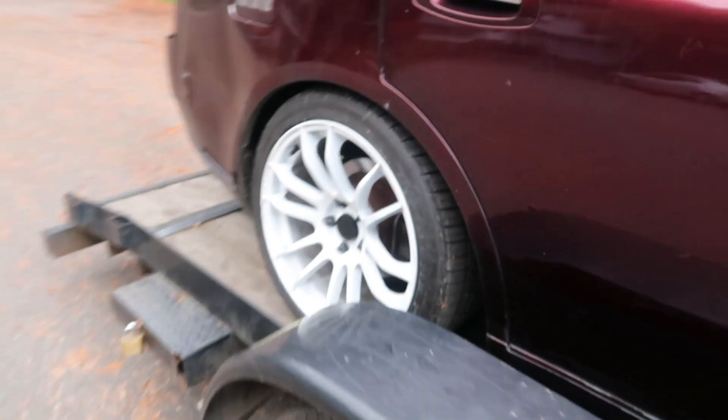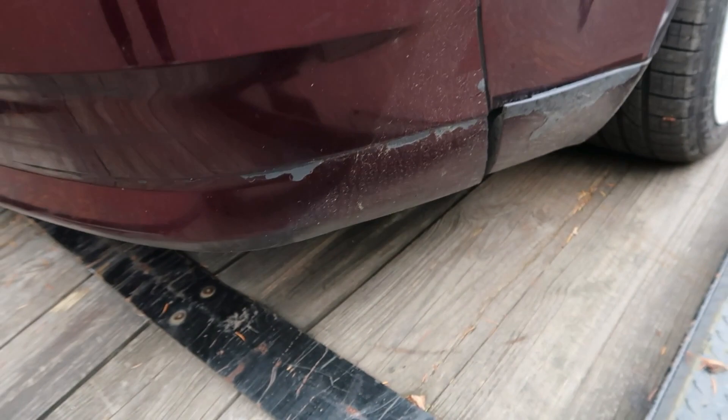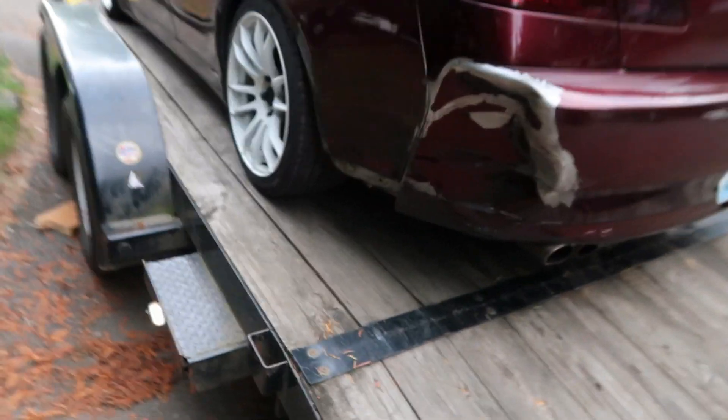This video probably doesn't have a lot of footage, but I did fix that ground thing. I had some of that heat-resistant tape that's like made of aluminum — it's kinda like a metal tape — so I put that on there to stop the hood from rubbing on it and chafing through the electrical rubber tape that was in there. Checked the oil; it seems good, at least from what I could tell. Gave the car a quick wipe down, cleaned everything. Wheels are looking — not the best, but better than what they were before. Same thing with the car — there's still a little bit of dirt, but it was a quick wipe down to just make it look like I didn't drive this thing through the swamp.